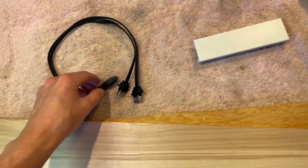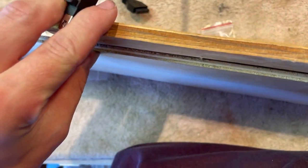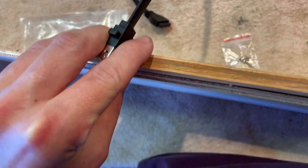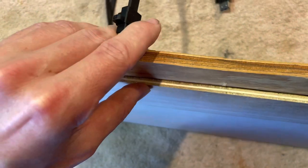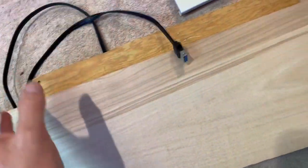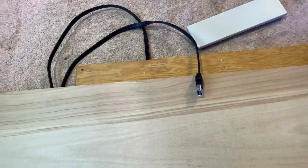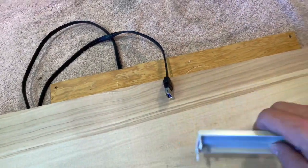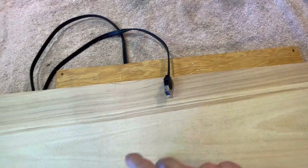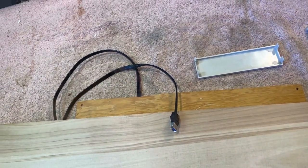Sorry for the long intro. So how I'm going to do the USB ports on the front is I'm going to put these two pieces of wood together — they'll get me right to the right thickness. This plywood is about three-eighths inch and quarter inch. I'm doing this one-handed so it's a little difficult, but this will get me right about where I need it to be, where these will be flush with the front. I'm going to trace this out, cut the holes, and screw it in. Then I'll make a spot on the back for it to screw into the five-inch bay.